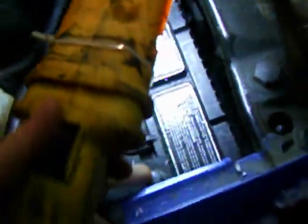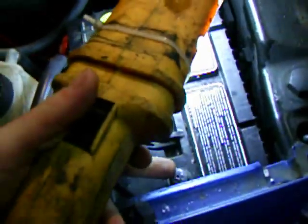Obviously there's the battery common — that's your big one and your reference point. You put your ohm meter on the negative of the battery and you probe everywhere else. The next one is right down near the bottom of the engine block where there's a big bolt — that cable right there also grounds your block to the battery.